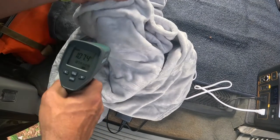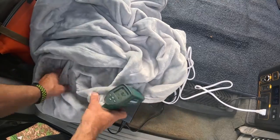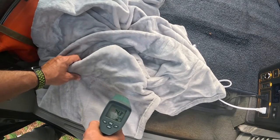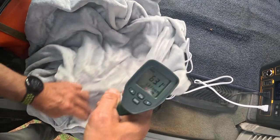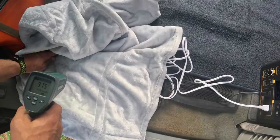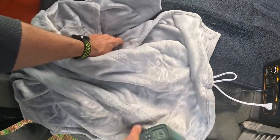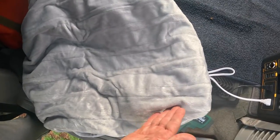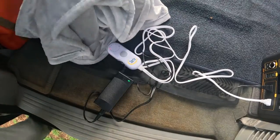The Serta reads 113°F, 107°F, 118°F — so they're about the same temperature, but this thing is using double the power. Here's where you see the contrast: there are lines right here — 98°F inside the coil, but 74°F, 77°F between them. Look how much of the blanket reads 63°F outside the coils, versus 97°F inside. So outside the wire lines it's only 68°F. Your actual heating surface is only within those lines — only about two and a half to three feet of heated area.